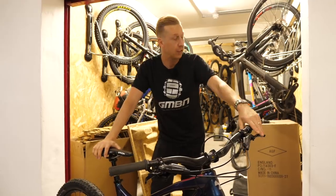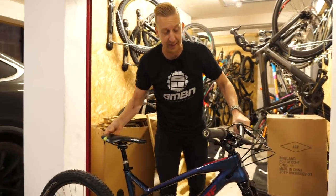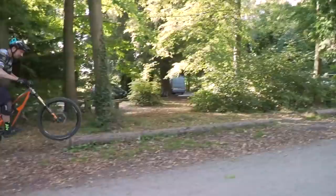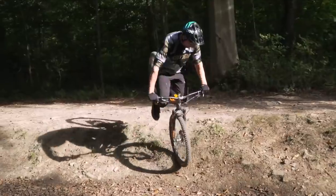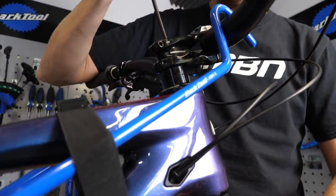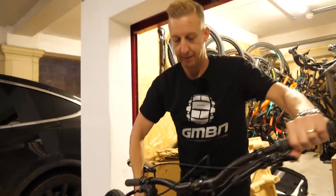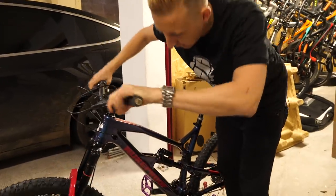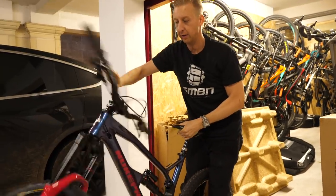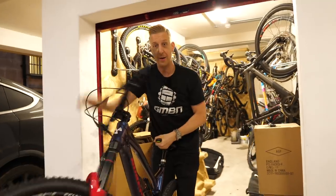Now it's time for top mods. I've brought you down to our little lock up because I want to show you something cool — a couple of top mods on Chris Smith's personal bike. This is his brand new Nukeproof 275C Mega in the Sam Hill colorway, that blueberry. Absolutely amazing looking bike. Chris isn't going to be doing any enduro stuff on this — he's all about jibbing and jumping. So we set his bike up so he can do bar spins by routing the front brake cable down through the headset. Instead of the cable running up normally on the outside, it runs through the steerer tube of the bike and pops up through a hollow cap. So you can sit there and run bar spins — not really my cup of tea, but for Chris who's a trick ferret, perfect.